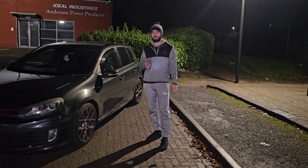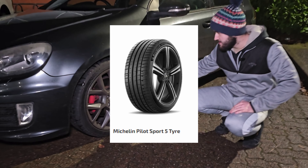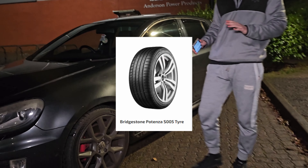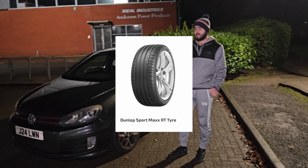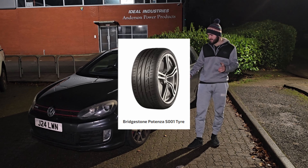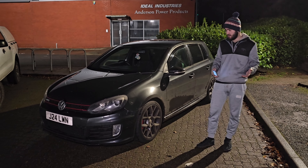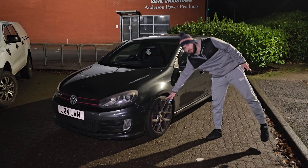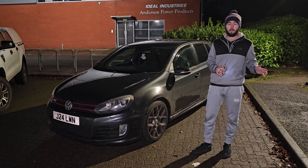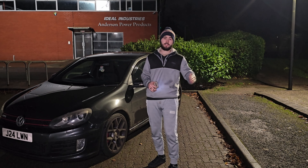The best mod by far — get yourself some proper tyres, like they are on this Mark 6 Golf GTI. These are the Michelin Pilot Sport 5s or 6s. Just get yourself some performance tyres and it will transform any car. It will feel much nicer to drive, you will feel the road more. Performance tyres are made of softer compounds, they warm up quicker, they grab the road better, and the sidewalls are a lot firmer. So when you're cornering the tyre doesn't flex and bow under pressure. Better tyres mean you can carry more speed around corners.